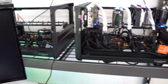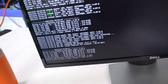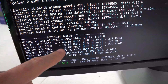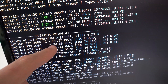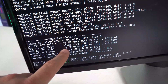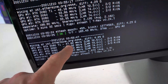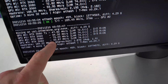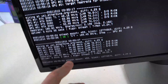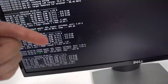The rig is up and mining. I used the default MinerStat settings for each graphics card. There are some issues with the 3080 Ti getting locked — it's auto-adjusting — but when unlocked we're getting close to 90 megahash. The 3080 LHR is getting around 72.8 megahash, which is pretty good. I need to check my settings on my full 3080 LHR build since I think thermal throttling may be causing issues there, but I'll let this run for another 10–15 minutes.